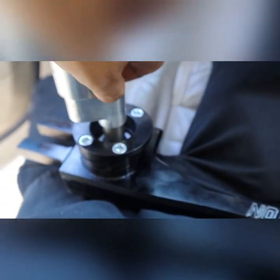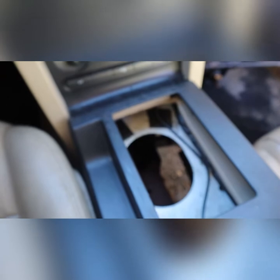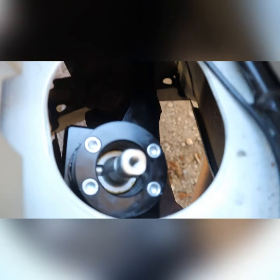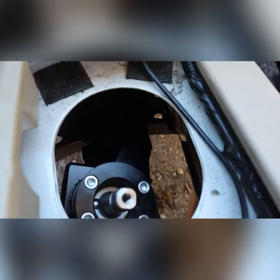Remember to take this bolt off — don't be stupid like me. That's why this thing wasn't going in. I got it in guys. There were two bolts at the top of this shifter, and since I got it used, the other person had it on a 2010 and moved some bolts to the front. You have to move it back for the 05-09, and it slipped right in. Now I've got to go under and try to adjust everything.